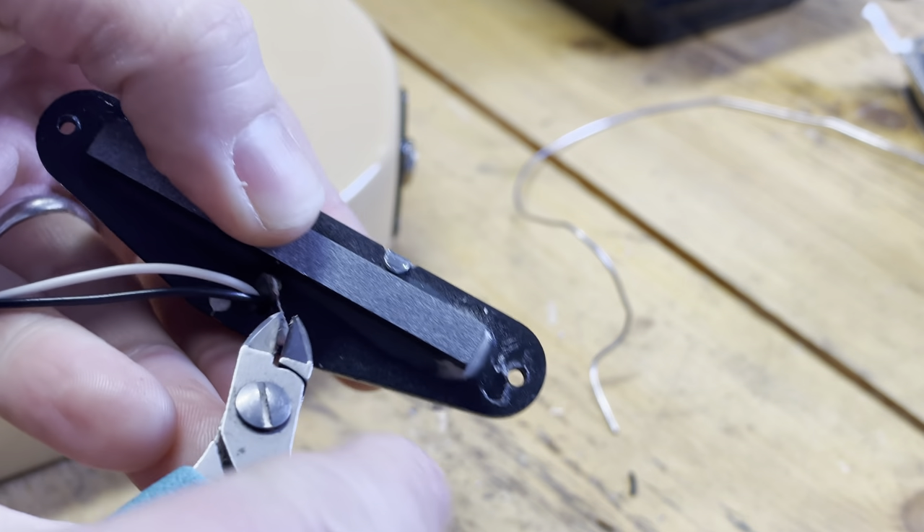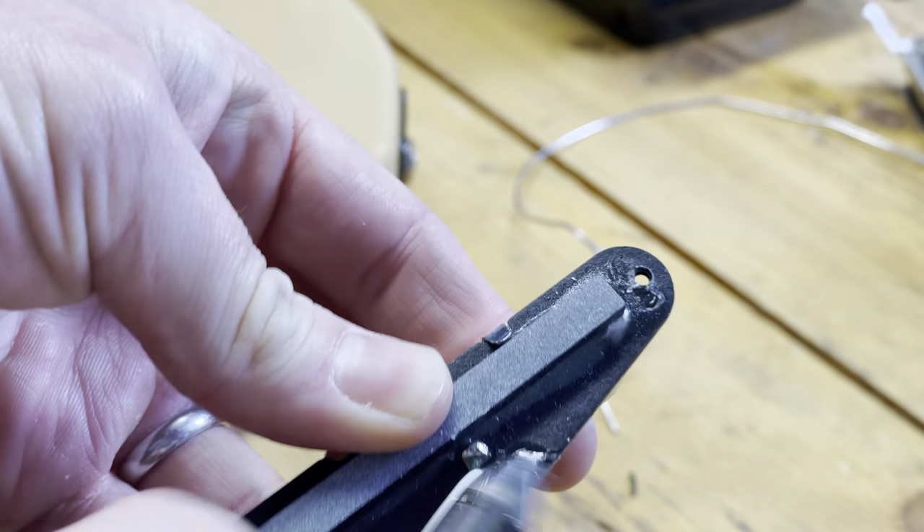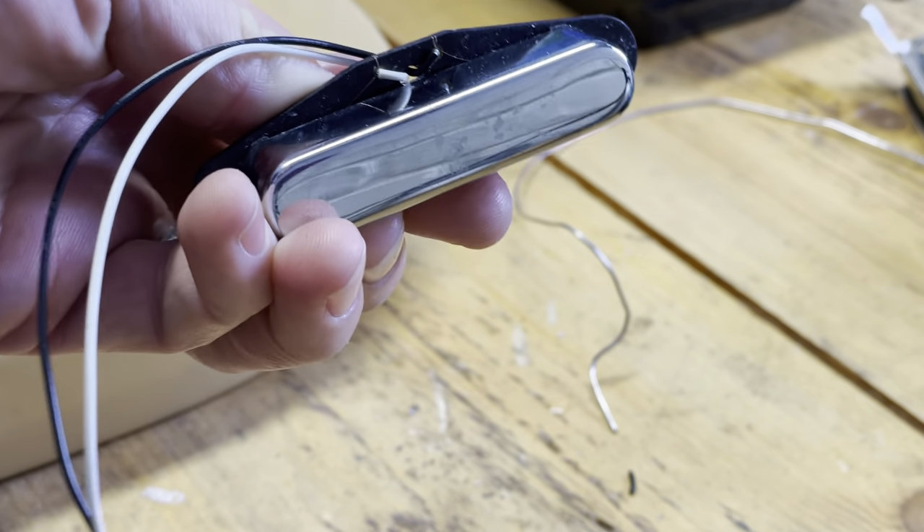You can see here that the cover is attached to the earth side of the coil, so I need to disconnect that so that I can get this to do what I want it to do. What I should do then is attach another wire from here and earth that to the back of a pot, but as this isn't going to be staying in here for long - literally like five minutes - there's no need to do it. So I'm just going to clip it here and clip it there. Now it's disconnected and we can access the coil without having to worry about grounding out on this thing.